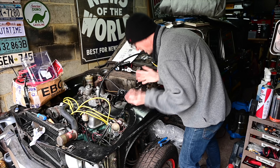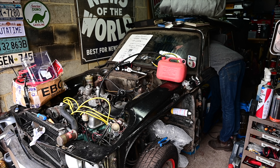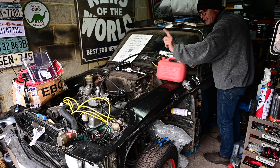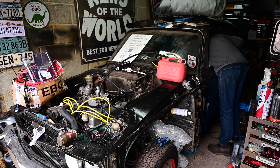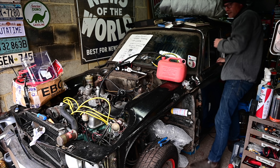Let's give this one final go with fingers crossed. We've got fuel pressure - you can hear the pump has slowed down. We know we're getting a spark and if it's getting a spark it's probably in about the right position. That was another double fuf. Oh - the choke's not connected! I think maybe something's not connected on the carburettor.